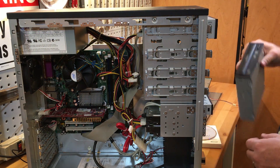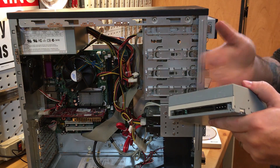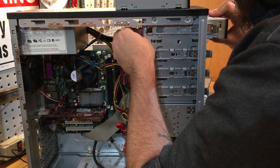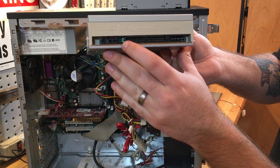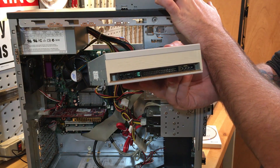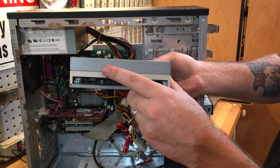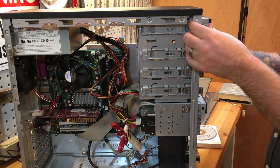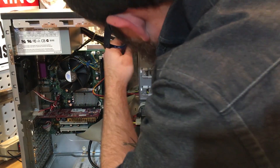So we found an old Sony DVD drive that's also IDE — a little dusty. We're going to swap out the CD drive. One thing you want to check is this little connector right here, these six pins. It is currently set on master, and we want to make sure this drive is set on the same thing. This drive looks like it is set on master as well. Plug in that IDE cable and the power.